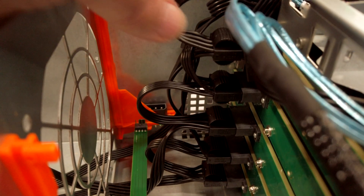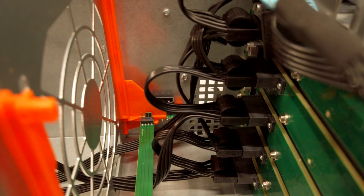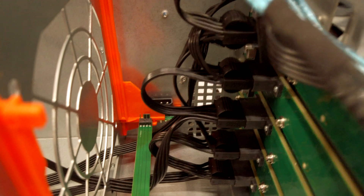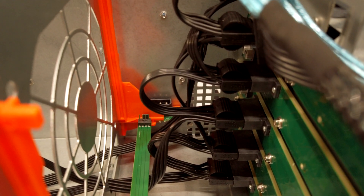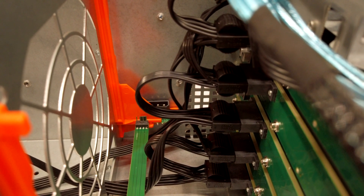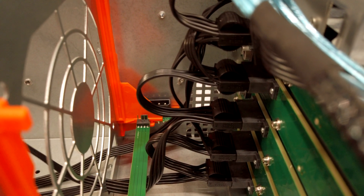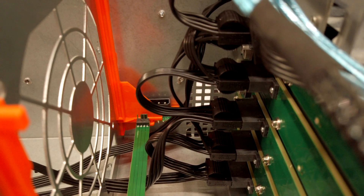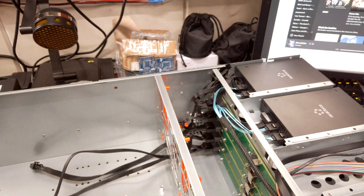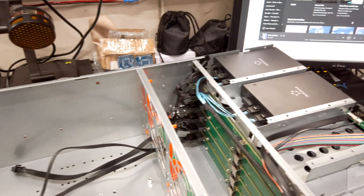Right now, the bottom, the one above that, and the top are connected through one cable, and then the third and fourth are connected to the other cable. I'll be spreading my mirror disks over those drive bays, partially to spread the heat, but also so that in the event there's a power failure and one of the cables would fail or come loose, because I'm running a mirror, the whole system — or at least that pool — would still keep functioning. More about that in later videos.